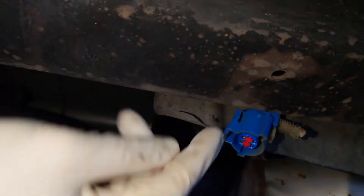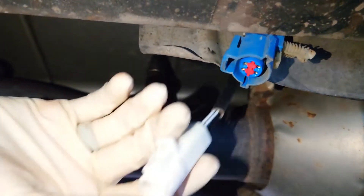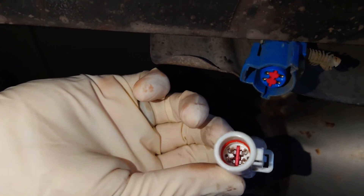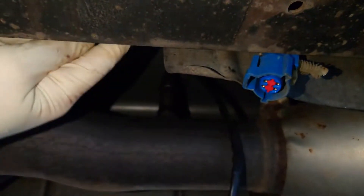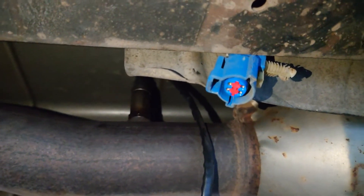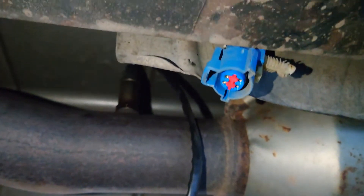As far as where this unplugs into, I went ahead and popped this little guy out. You have to push this heat shield pretty hard - I guess at some point it got bent. Take your little connection here, it's a quick connect, so you literally just pop it in and it'll click into position and you're good to go. Just pop that back behind the heat shield, start up the vehicle, and we'll see if we're getting data from this O2 sensor. I'm going to tighten this a little more but I'll need two hands so I won't be able to show you that part.